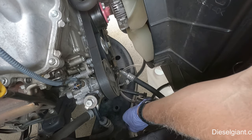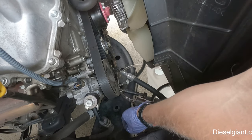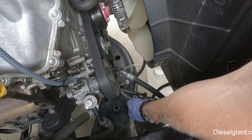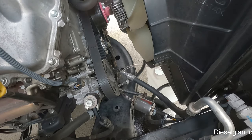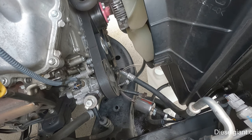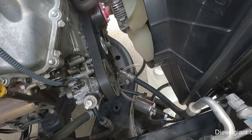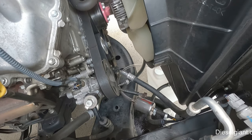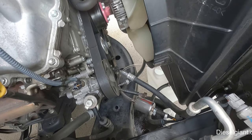But sometimes, just with the transmission pumping, some can weep out. I've just got the end of this in the 5 gallon bucket here, so I'm going to crank the truck up and you'll see the fluid. There'll probably be some sputtering at first because there's air in this line because I disconnected it, but let's see what happens.